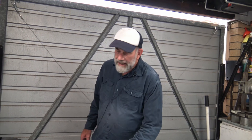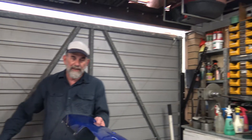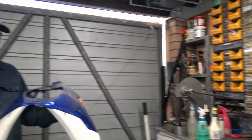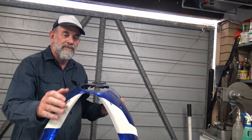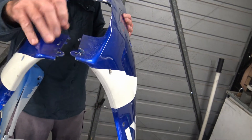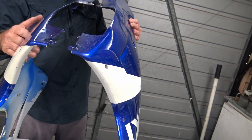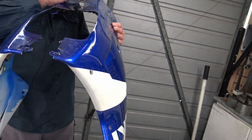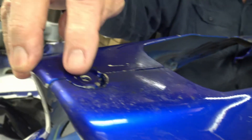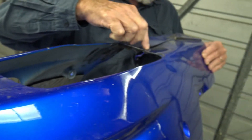I've just breezed through the removal of the damaged fairing and it may not be clear as to exactly how it all comes apart or how it will all go back together. When you've got a damaged bike it doesn't really matter how it comes off because you may have broken parts which are difficult to get off. I like to start at the bottom if the panels are good, and I'm going to show you how you do this when the panels are good. You've got three panel clips — one, two, three — that hold the bottom halves of the fairing together. There are also locating dogs which engage between the panels, and panel pins that should be in those three positions.